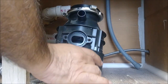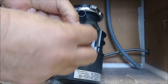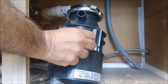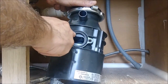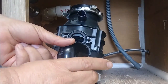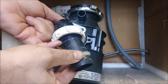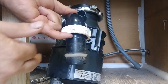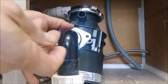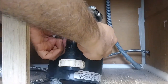We've finished removing the putty from the flange, so now we're going to install the discharge tube. The first thing we put is this rubber gasket — you can see how flexible it is — inserting it inside like that. Then this is the discharge tube, and here's another gasket to connect it firmly. There's also a washer with a Y-shape that I removed from the old garbage disposal. It comes with two screws, so I align it and insert the screws.